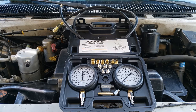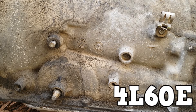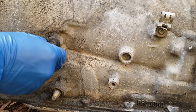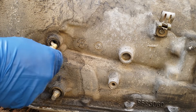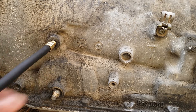For these tests, we'll use a bi-directional scan tool and the Maddox engine and transmission oil pressure test kit — you just need the hose and the 400 PSI pressure gauge. These vans use the 4L60E transmission. The line pressure test port is located on the driver's side, just above the neutral safety switch. Remove the plug with an 11-millimeter socket and a 3-inch extension, then simply thread in the gauge's hose. No special adapter is needed — I lightly snugged it up.